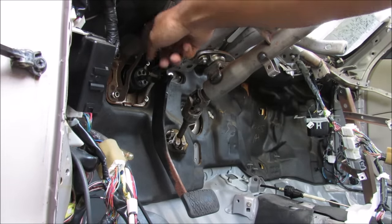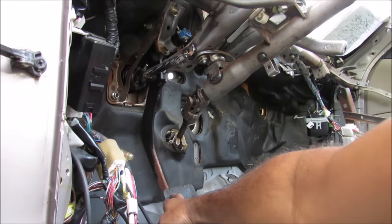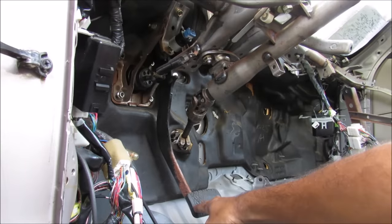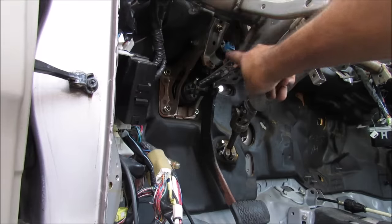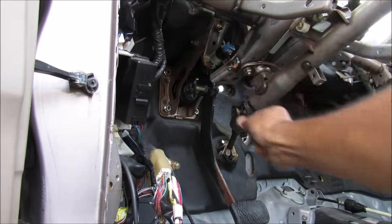At the top here we have a pivot point, and near the top we've got this push rod that when you press the brake it will actually push the push rod inside of the brake booster. Having this long leveraged arm gives you a nice mechanical advantage. At the top here I have a stop light switch which will control your brake lights, and then I've got a return spring that I can remove here.